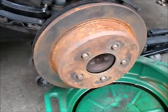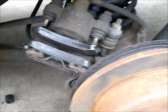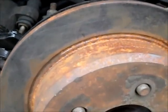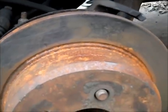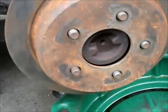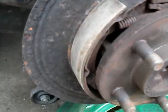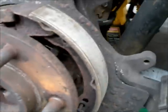So right now this is the left rear brakes — the whole setup. There's your caliper with new pads, and this is the rotor. I just gave it a light sand with some 80-grit sandpaper. If you look closely, it still has its original factory finish from when it was brand new. There's a little bit of surface rust, but these are actually pretty new. And the parking brake — if you take the rotor off, right there — it's very, very similar to drum brakes. I mean, it essentially is drum brakes.